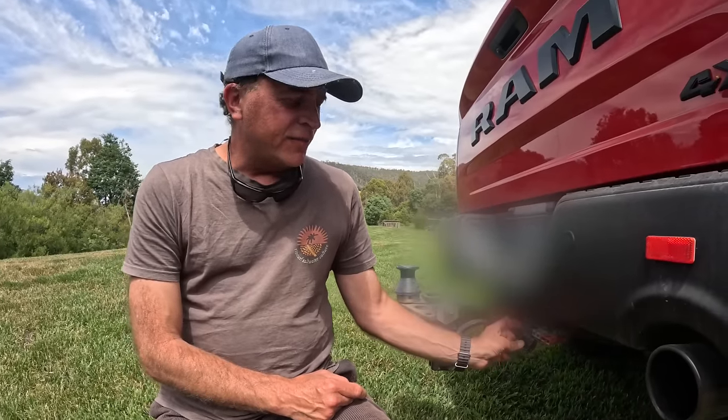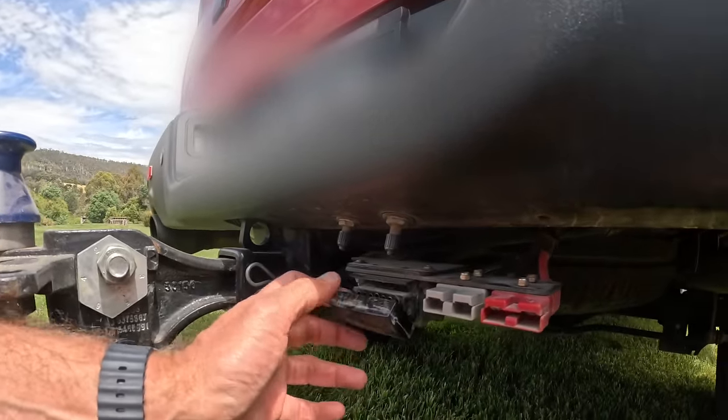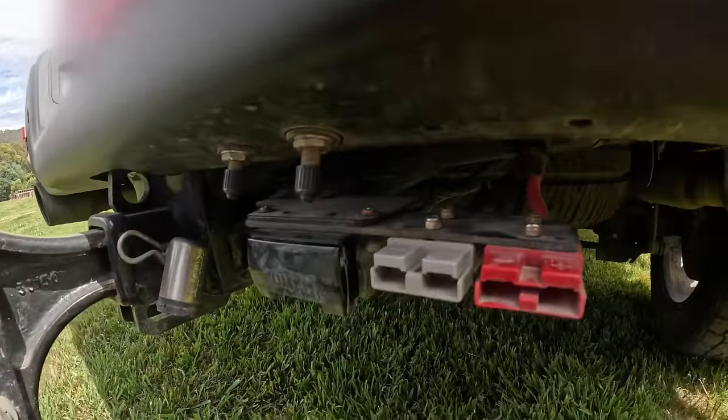There are some maintenance tips that you need to make sure, probably once every few weeks, that you have handled with these plugs to make sure you're not going to have these instances where you're not getting power to lights and brakes and so on. At the back of the car we've got the female end of the 12-pin plug, a gray Anderson plug, and a red Anderson plug. If you have a look at these Anderson plugs they're actually quite dirty and dusty — that's just through our normal day-to-day travel.